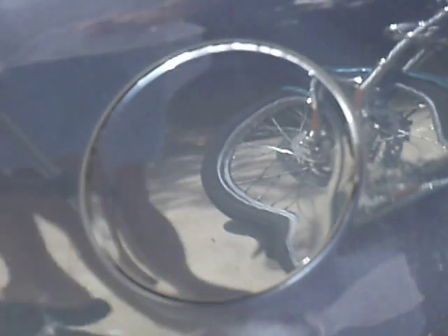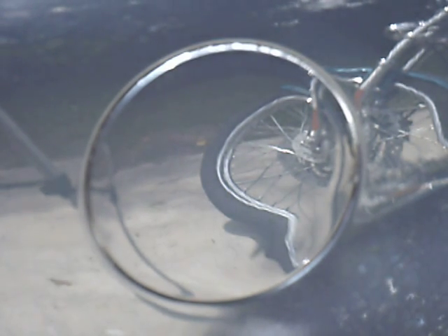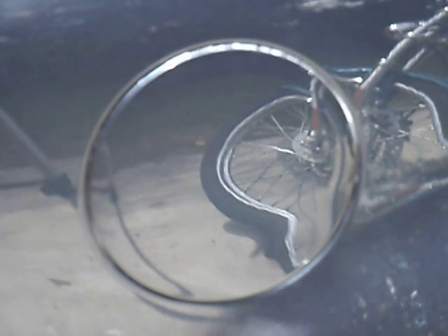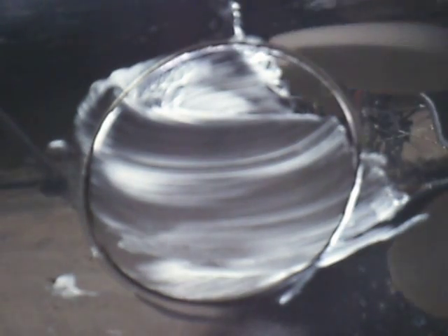Once the compounding phase is done, I'm going to swap and put on a polishing pad. I know this is oversized for the job, but I've got to do the whole car on the step system here. We're going to polish this out and bring the paint back. We're going to slow the wheel down to about 1,000 RPM — we don't need the speed anymore.